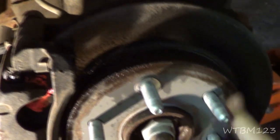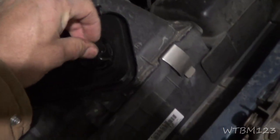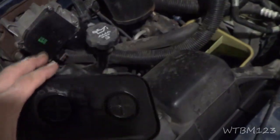Make sure you don't get any grease on there - I like to just spray a little bit with brake cleaner and then rotate this. Remember also you push these calipers back, so the first time you go to use the brake pedal it's gonna be soft - pump the brake up before driving. With this kind of master cylinder lid when you go to put it back on, you want to push these back up in place because when you hit the brake pedal the fluid goes in and out of the master cylinder. Make sure you have them on there - there are four clips on the side, just make sure they're all clipped on.